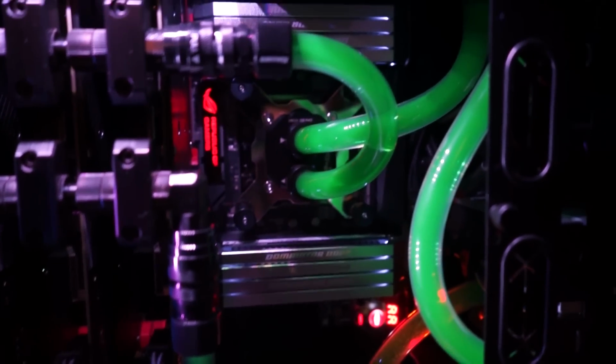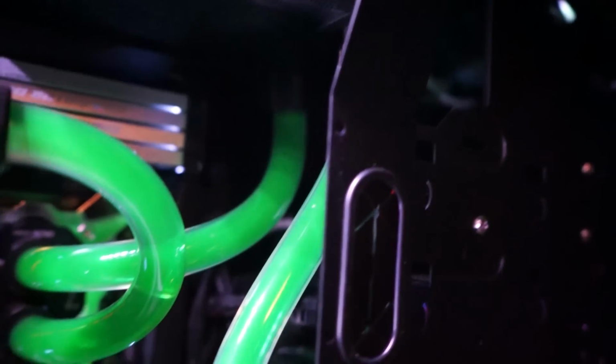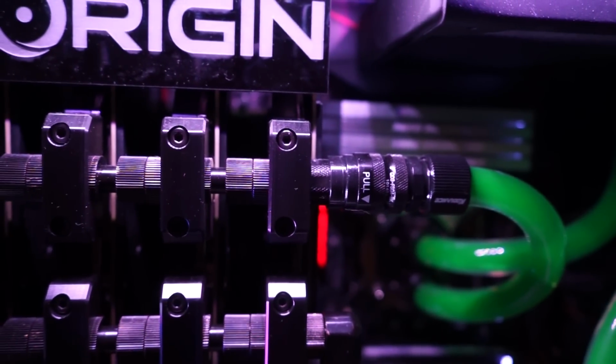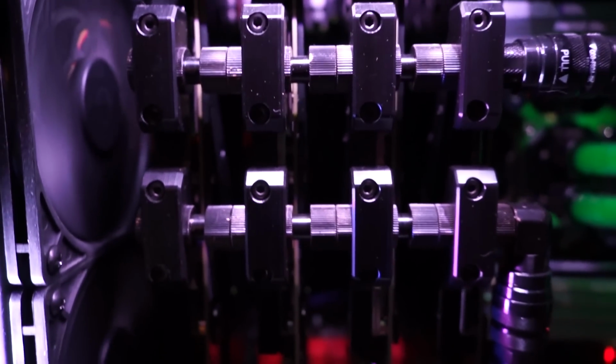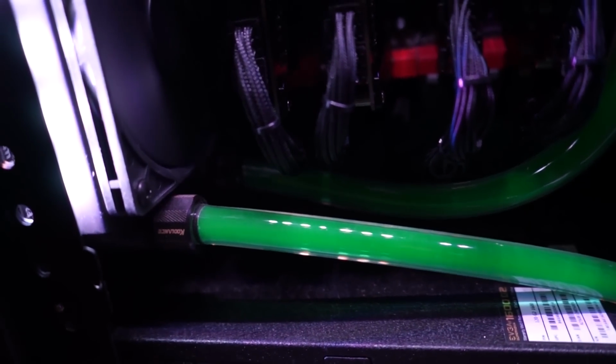So basically the liquid cooling feeds from a reservoir that I can show you guys in the back over here. The reservoir starts from there, then it follows this tube up into this radiator, filters through this radiator, drops down, goes into the CPU, comes out of the CPU, pops into the first card, then it fills up through the first card, then it goes into the second, the third, the fourth, and so forth. Drops down through this quick connect fitting, goes down into this radiator, fills up through this radiator, and then comes back out again, drops into the basement where there's 2 more radiators down there that I showed you, comes back out, and then into the reservoir again.